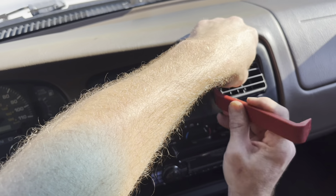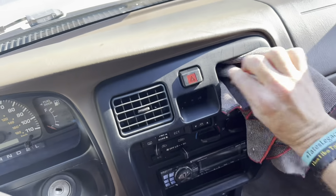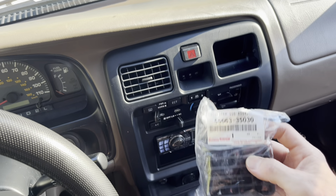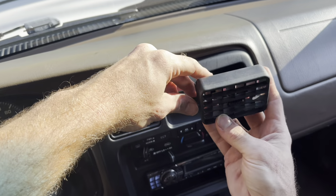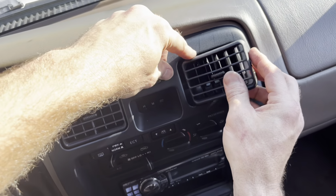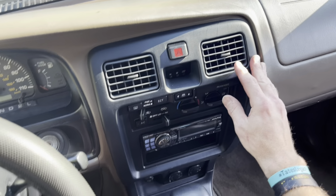We're gonna do the same process here. Yep, from the inside. Grab the old one. There we go. See you later. And we're gonna clean in here while we're at it. You know, why not? And again, we've got the two pegs there. This is our second new air vent. And we're gonna approach this one in the same exact manner here. Yep. One of these pegs is smaller and one is larger. The smaller peg goes on the side with that grommet. So I'm gonna seat it in, okay? And I'm gonna take my body panel puller and create a little bit of space there. And there you go, snaps in.